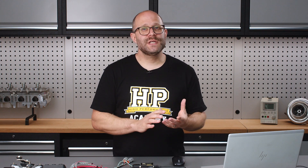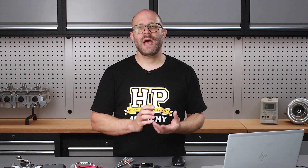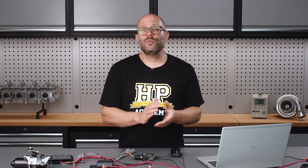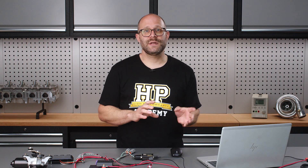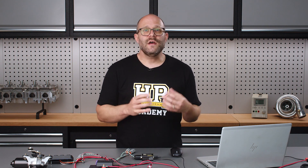When a system like this is implemented with fuses and relays, the items that receive power at each stage are hardwired into the harness construction itself. The relay coil wires will be directly connected to physical switches, meaning the only purpose that switch can ever have is to control that particular relay and its connected components. We still need switches and buttons in our system. The beauty of using a PMU is that the input signals from these switches are decoupled from the direct activation of its outputs, meaning if we need to make changes later we can accomplish this in software without rewiring anything.